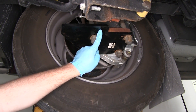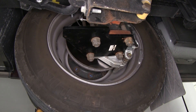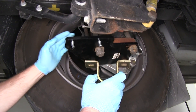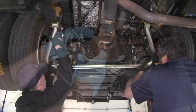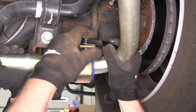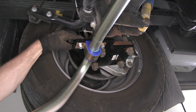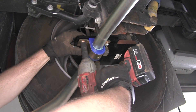Now you can see there's going to be four bolt holes on our plate. We're going to use the forward holes — that one and that one — positioning our bar more forward. We're going to take our 7/16ths bolts, drop them through. Once we have our bar intact, that'll slip up over that and we can put some nuts and washers. Once we have it in place, we can just let it swing down. Now we're going to take a 5/8ths wrench, place it on the top of our bolt, and an 11/16ths socket, and we're going to tighten up the four bolts that hold our sway bar to the bracket.